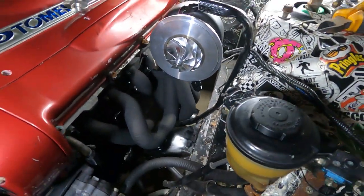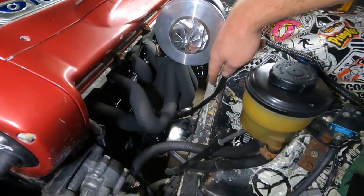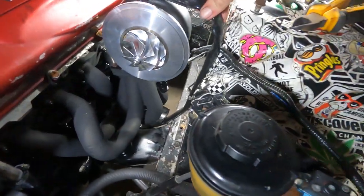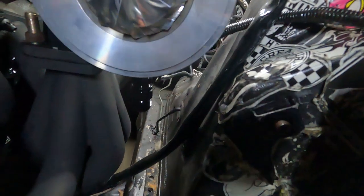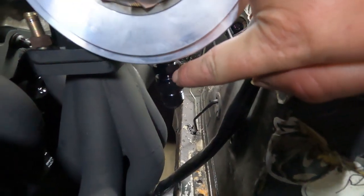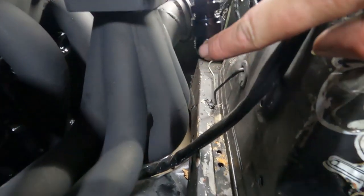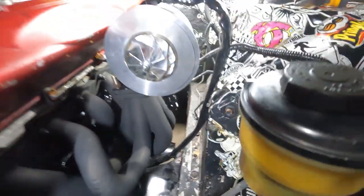Righto, guys, that's how we look a little bit dummied up. It's about how it's all gonna sit. As you can see, our feed line is long enough to be well away from that manifold as long as possible. And it also, of course, has our heat sleeving all over it. You can see how our drain fitting ended up. So that is the extended dash 8 plus the dash 10 adapter, I should say. So then from there down to our drain fitting that we put in at the end of last episode